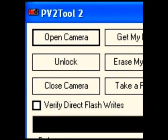Now go ahead and run PV2Tool, and plug the USB cable into the connection you made and your computer. With that board exposed, please be careful and avoid the flash capacitor — that's 200 to 300 volts, it's going to zap you hard. With PV2Tool running and the USB cable connected between the camera and the computer, go ahead and click Open in PV2Tool. Hopefully you'll see PID27 if you're using the CVS RED camera.